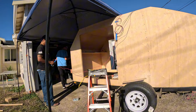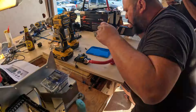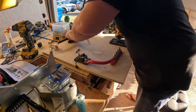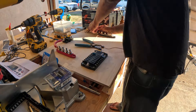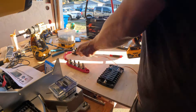Now we're on to the electrical. We are running wires for two interior reading lights that have USB ports, two overhead lights in the cabin, a 12-volt cigarette plug in the cabin for a CPAP machine, the MaxAir fan that's going on top, and two exterior lights that will be shining with switches on the inside. Additionally in the galley there will be a control panel, lights in the galley and in the hatch, and strip lighting in the cabinets inside and out.